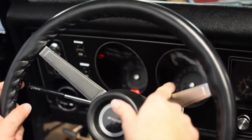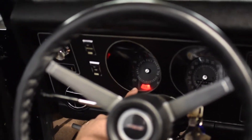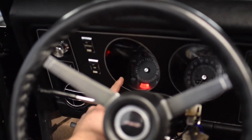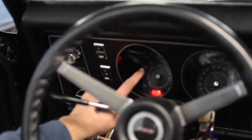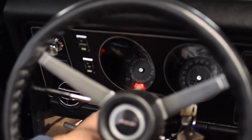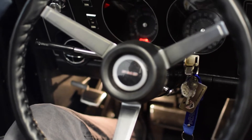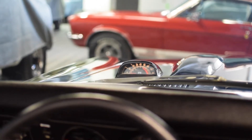Inside the gauge cluster, we have the speedo on the right. On the left side there's a generator light — if that comes on while the car is running, it means your alternator belt broke and you're running off pure battery. To the left is the water temperature gauge, which should generally be in the middle or just above or below the middle, towards 250. Up top is the fuel gauge, and all the way on the right is the oil pressure gauge, which typically runs pretty high when cold and settles back to the middle when warm. The horn is right in the middle, and up on the hood — the tachometer is showing right there.